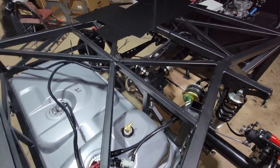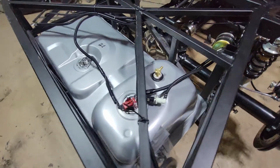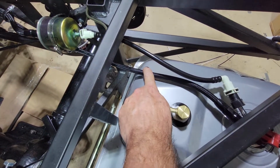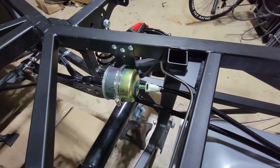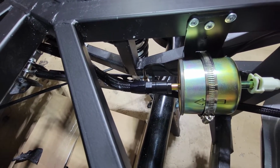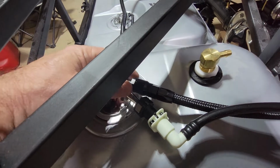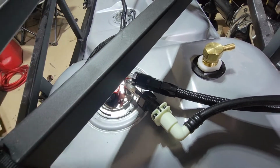And then here's the fuel line arrangement. So again, using everything stock. I'll go this side. We've got the high pressure line, which is the plastic line, and the return line. They supply these really nice fittings now. Then the stock fuel filter that comes with the kit, a nice arrangement there, and the same deal on the return line, rotating around. These still have to get tightened. They're still loose, so I'll tighten those, and I'll mark it so I remember it's loose.